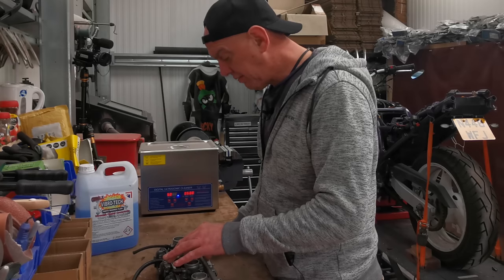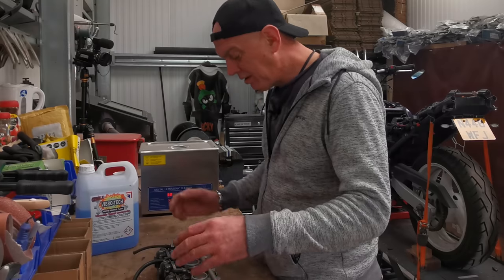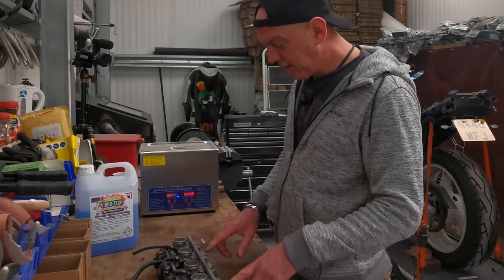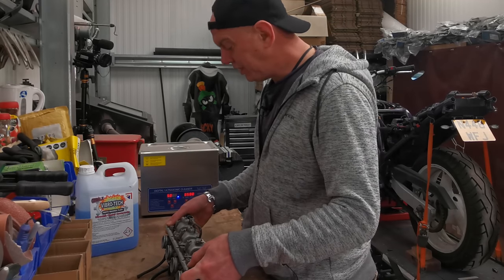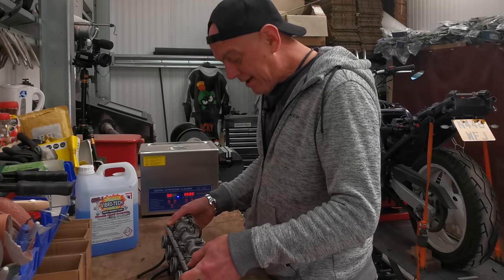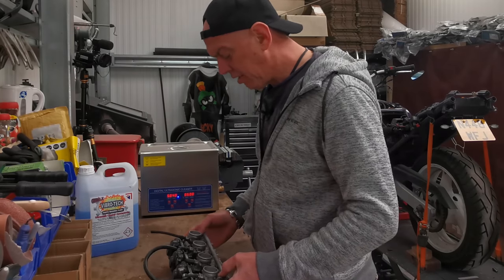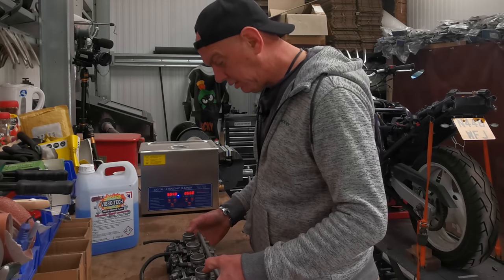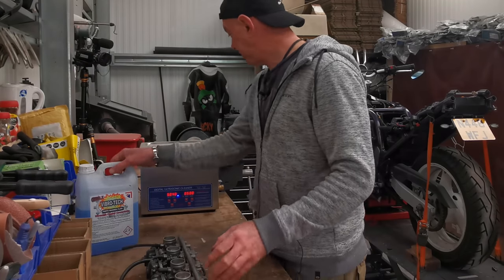So yeah, I'll be Googling stuff as far as setups go. The float needles, the needle positions and all that other stuff should all be as it is. But it's things like the air fuel mixture screws, they're all set differently. That's stuff like this sort of adjustment that I need to get right. And then we're going to have to sync them and everything else. So I've got to get some of that sorted. I've got loads to do. Right, enough chat, let's get on with it.